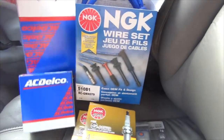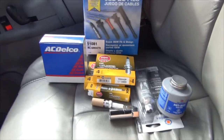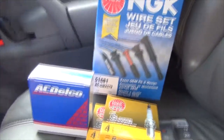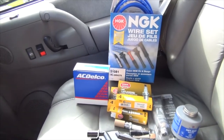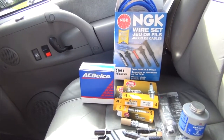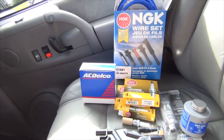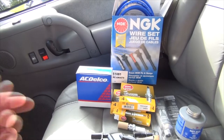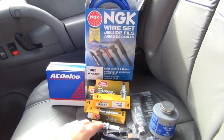Typically you should stick to OEM parts, so I'm definitely doing that for the distributor cap and rotor. But this time I'm going to go with NGK wires and spark plugs simply because they're advertised as OEM equivalent or better. However, one time I used NGK on this particular truck — a 4.3 liter V6 from GM — within 6 months I had issues: it felt like camshaft timing was off, getting knocking and pinging. I took out all the NGK stuff and put back in the AC Delco Professionals, which is what I have in the truck right now, and it's been running great since.